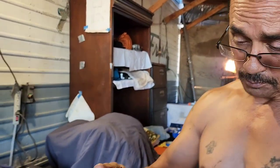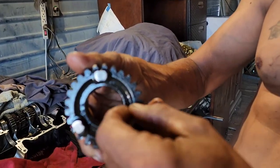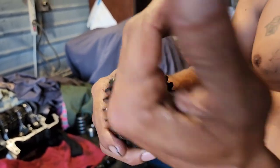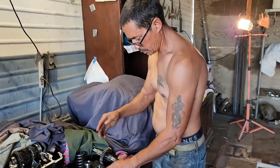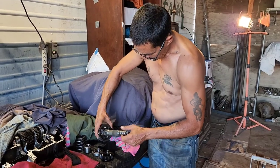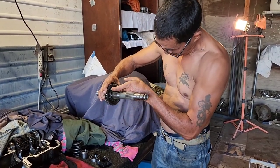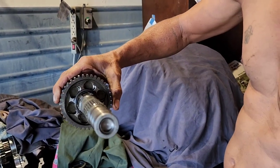No, take your arc welder, weld a bead across here. Just goober a nice bead on it. Weld it, weld it, weld it. Reshape it with a grinder and a Dremel. Reshape it, re-dovetail it, so it's flat. And then in here, take your Dremel and dovetail it. And that will take care of that problem.